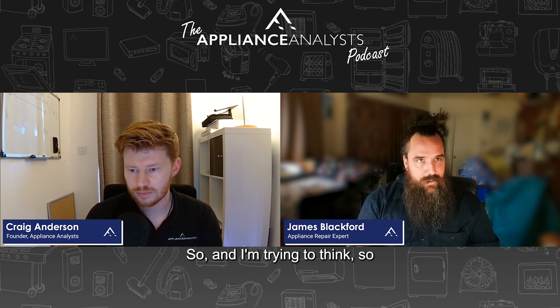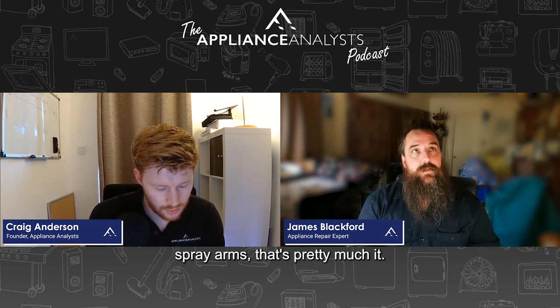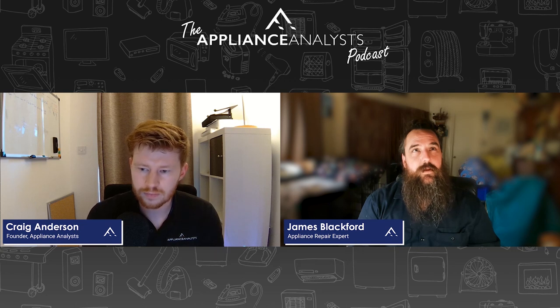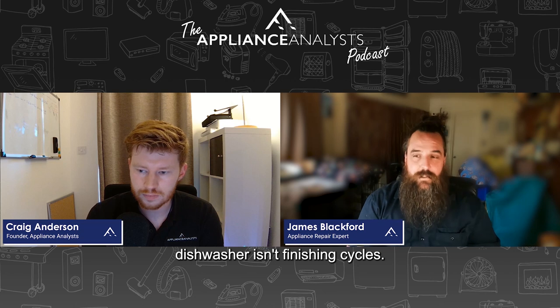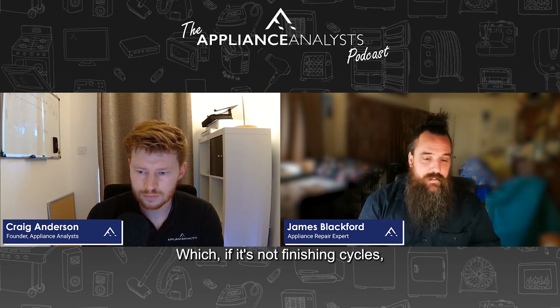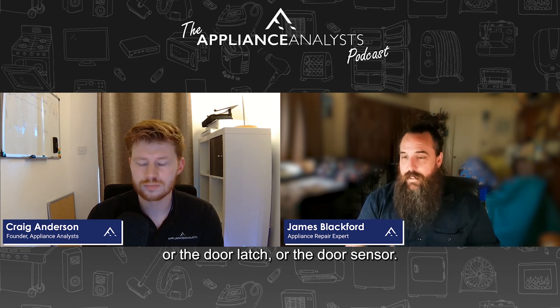So, I'm trying to think. That is the heating element, the wash motor, the spray arms. That's pretty much it. Sometimes there are some weird things that could happen where your dishwasher isn't finishing cycles, which, if it's not finishing cycles, could be an issue with the door lock or the door latch or the door sensor.